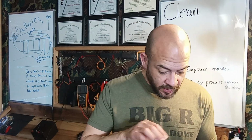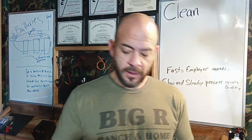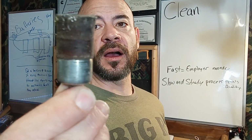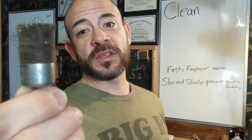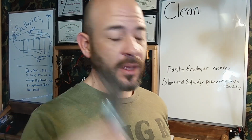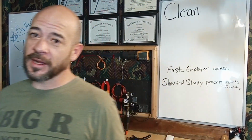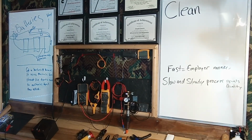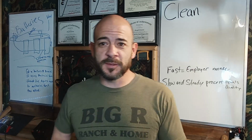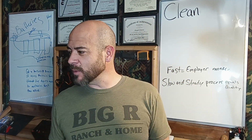Another one that I wanted to show you, because I don't see people use it a lot, is the bonded resin wire wheel. What this does is it improves the likelihood of those wires not flying off inside of the engine or any other place that you choose to use it. But if you're using a wire wheel around an open engine block, it's very dangerous. It could crash a gear or really rob hundreds of thousands of miles if you don't make sure you cover off all the oil ports. I've seen people scraping their head right into the oil gallery. You just think, gosh, man.